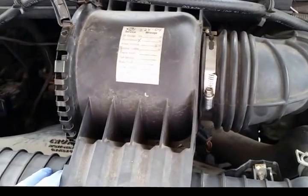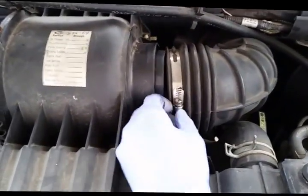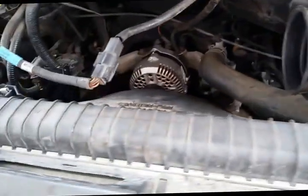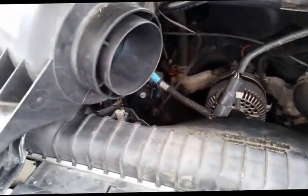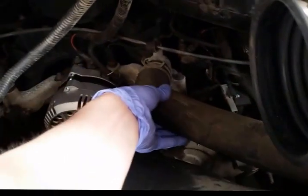I've taken off the four screws here and released this — I used my same 8mm socket on it, but you can also use a flathead screwdriver and simply pry it off. So now this piece lifts right out of here. We've got a little sensor here that we need to disconnect. Keep in mind that this piece is optional — even with it in you are able to get at that upper hose — but for the sake of having enough space, I went ahead and took it out. I'll grab the tools necessary to start working on the upper hose.